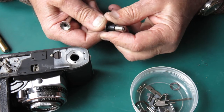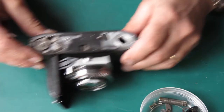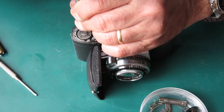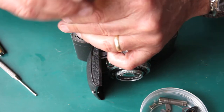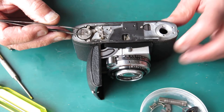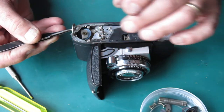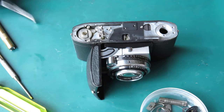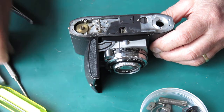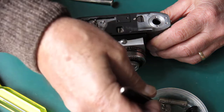The shaft should come out of the bush, and the centre of the shaft should come out too. Back to the camera body — I'm going to take that screw off the top of the film advance shaft. The little pinion gear there on the top, I'm very interested in the state of that, to see if it's still any good. That's the drive dog that drives the film advance shaft around — the take-up spool. Two screws hold that bush in place at the top. Now that one was loose — it may also be bent, I don't know yet.